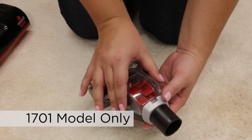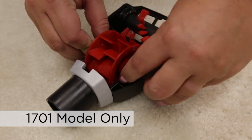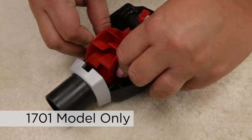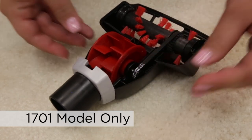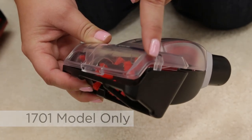Once the slot appears, separate the faceplate. If the paddle wheel gets dislodged, align the two clips on each side and pop it into place. The faceplate will not close properly if all the parts are not aligned correctly.